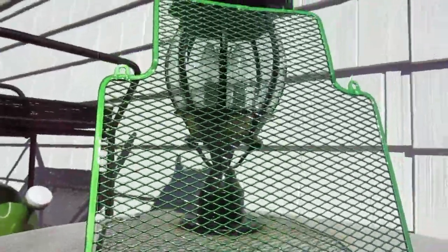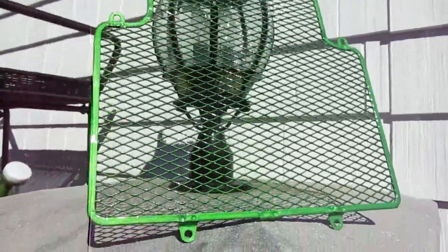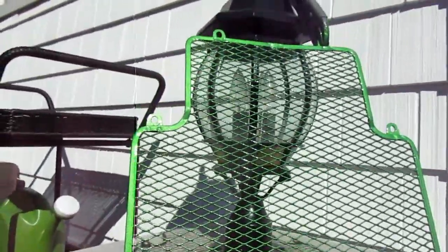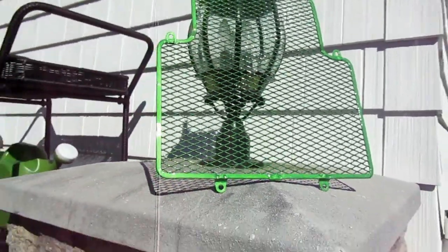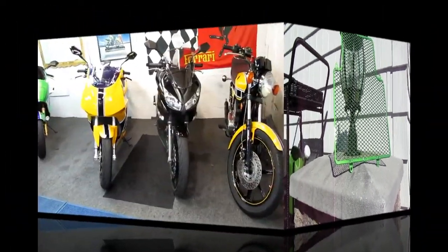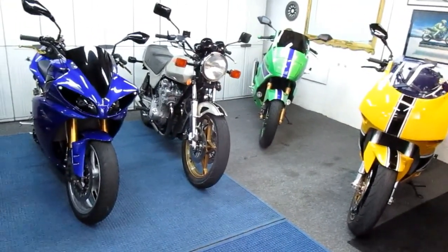Got two coats of clear on that, and I think that's going to be just fine. Again, making evil twin parts, as long as you can go back and undo it, you don't run out of your original paint. And boy, it's so important to have matching paint when you have old motorcycles. I always say never buy the pint, always buy the quart, and I have been right more than I've been wrong. So we put that part aside to dry a couple of days, doesn't have to be buffed out. Very easy to put it back.